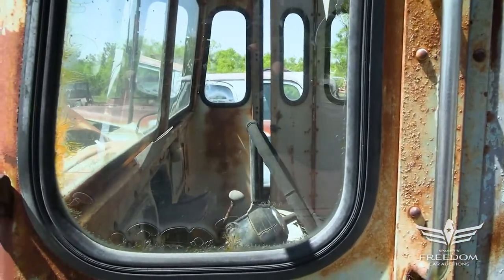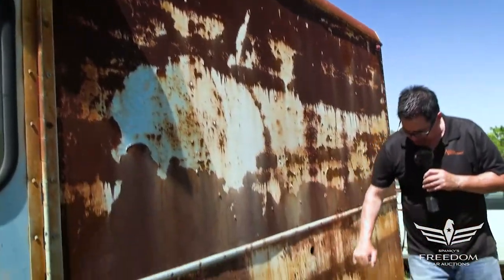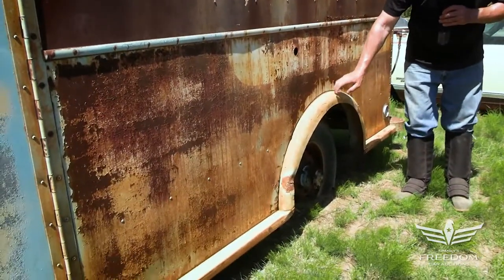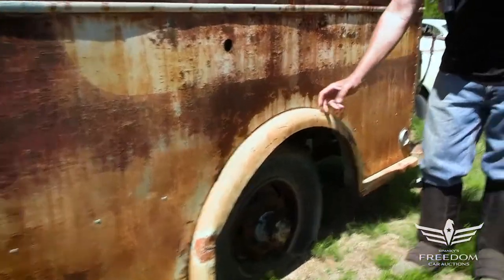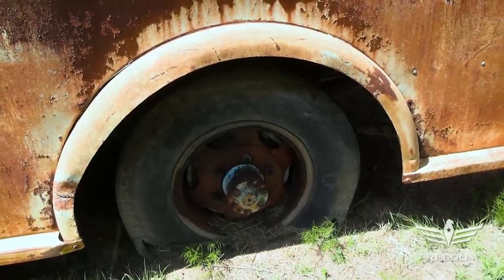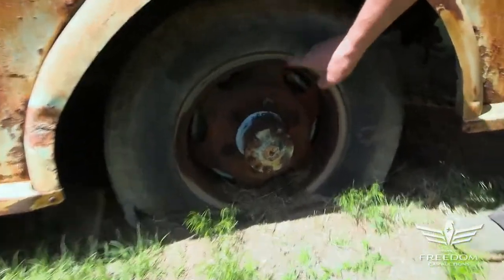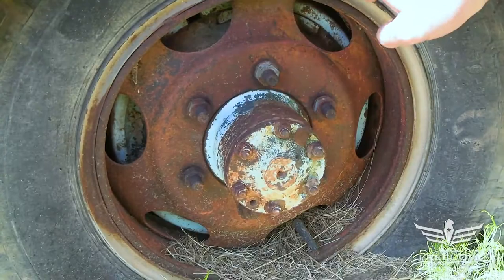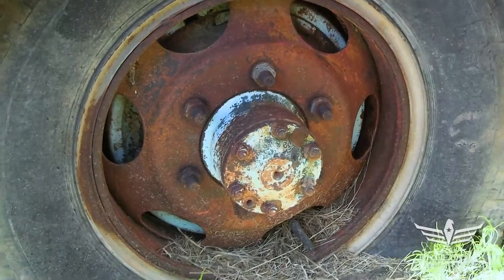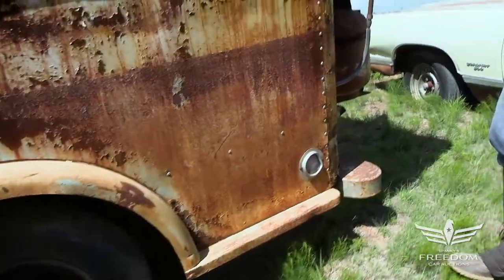The commercial body itself is kind of rusty — it's steel, not aluminum, with a bit of surface rust on it. These rear fenders are Dodge items; I believe the Dodge Power Wagon line yielded these fenders, which were supplied with the cab and chassis. This is a typical Dodge heavy-duty two-piece split rims, Dana 60 rear axle, big full-floating axle shafts. Dodge stuff right there — kind of hard to find when you need it.